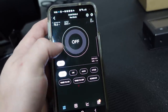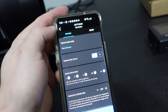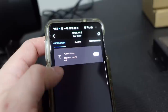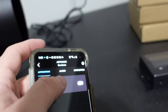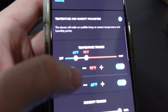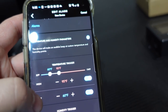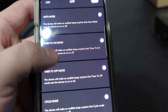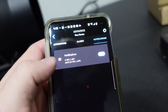You can set it to auto mode — I'll turn that on in a second. Under the settings tab there's an automation section where you can fully automate this: during the day do this, during the night do this. There are tons of automation options. Under alarms, I've set it so if it gets below 60 degrees Fahrenheit or above 95 degrees Fahrenheit, the device makes an audible alarm anytime the auto mode kicks in.